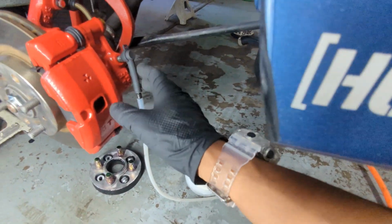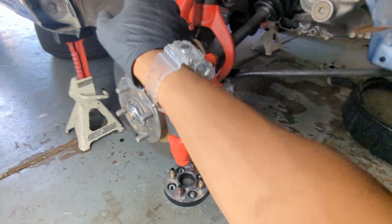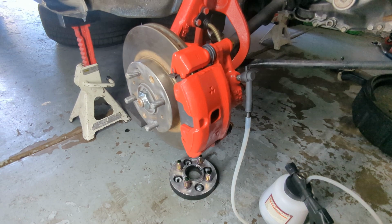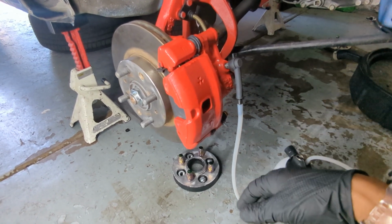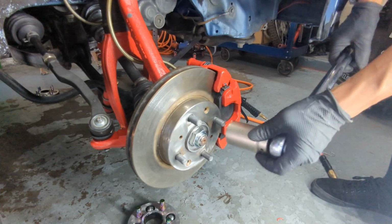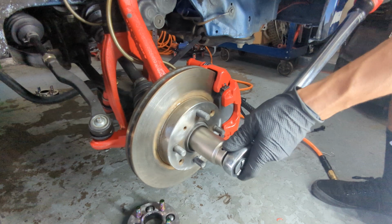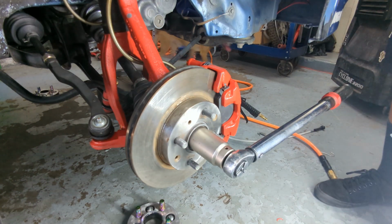Alright, I'm using this thing here. I haven't got any brake fluid to come out of the bleeders yet, but I have got the brake calipers to lock up. So I'm going to torque my axle nut here and slap the wheel on and start it up, and hopefully the brake booster will help me get some pressure in here. I guess it's not holding strong enough.